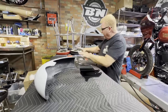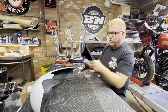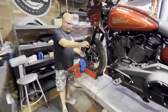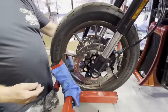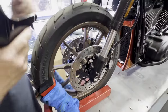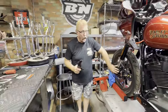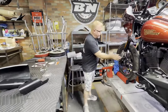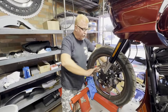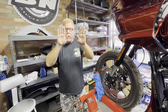The first thing you're going to do when you unwrap the package is you'll have a pair of our inverted fork adapters. These bolt on the front end at the lower knuckle right where the stock fender bolts on — on each side, mounting at four points total, two on each side. These are a cast part — what I call a knuckle on the bottom of your inverted fork. The surfaces here have rough casting lines and have also been powder coated, so there's no way those four surfaces are parallel to each other or all on the same plane.